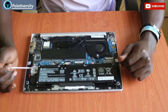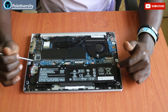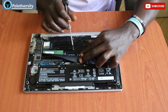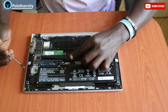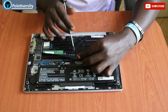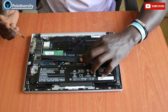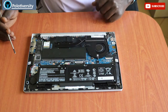For this troubleshoot, we need to first disconnect the battery — this is the battery we're going to disconnect. Then we'll have to remove the RAM. This is the RAM, the DDR. It has two RAM slots: this slot and this other one. In case you need to upgrade your RAM, you can fix a second RAM stick into the available slot, or if you just want to use one chip, you can remove and upgrade it to what you prefer.